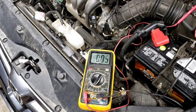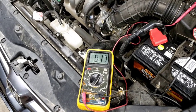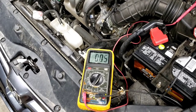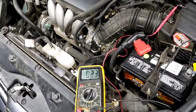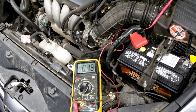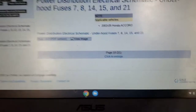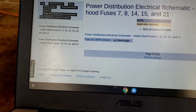Fuse seven dropped it to 50 milliamps — put it back in, pull it out. Fuse 7 is our issue. Down to 50 milliamps, that's within our acceptable range. So now we need to go after the circuit on fuse 7 and pull up that diagram.